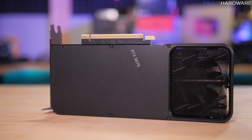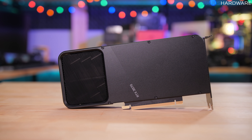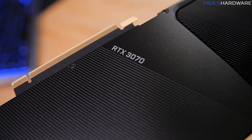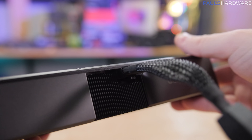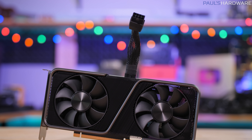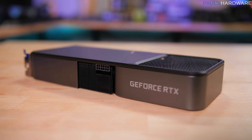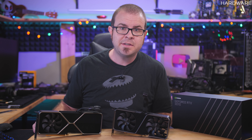Once again, we have a flow-through area towards the end of the card that allows air to pass straight through a finned section with two axial fans. I really appreciate how NVIDIA has taken the functional element of the black heat fins and made them quite visually appealing. It has a nice backplate and some RTX 3070 accents. The only real downside is that there's still this special power connector placed in the worst possible spot, so you're going to need the adapter dongle it ships with until other solutions are available. It also seems even less necessary with the 3070, since it only requires a single 8-pin power connector. Also worth noting, there is no light-up GeForce RTX logo or any lighting anywhere, as there is with the RTX 3080 — for some people that's a good thing, and for some people that's a bad thing.